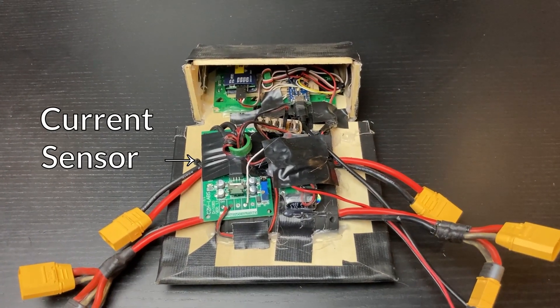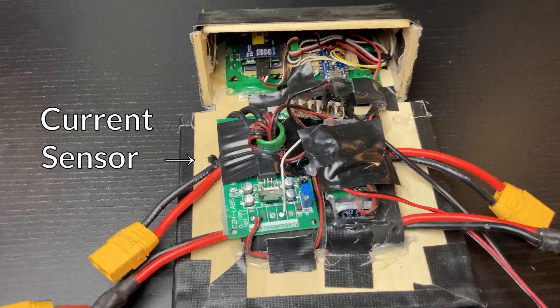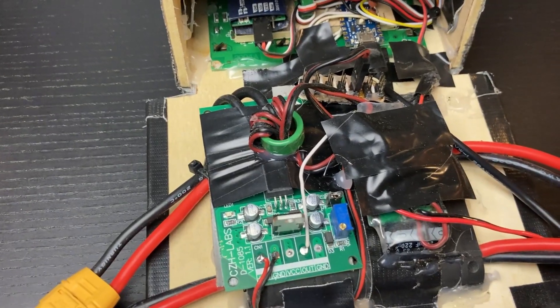Third, we want to be able to use full power without worrying about burning up the motors. The main motor can handle about 100 amps in steady state and 150 amps for 10 seconds before overheating. In order to ensure we stay within these limits, I put a current sensor on the Arduino so we can track exactly what is going on. Then if the thermal load goes above the allowable limits, the Arduino automatically cuts the throttle back below 100 amps to allow for effective cooling.